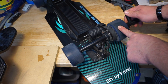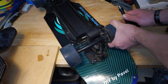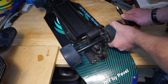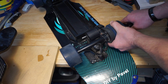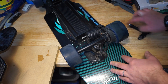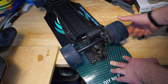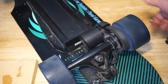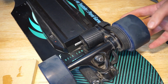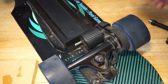What I normally do is start tightening the wheel nut and at the same time rock the wheel. If I feel a wobble I keep on going until the wobble stops. Then I just check the spinning of the motor and the belt — it should spin nice and freely and make three or four turns after you stop spinning by hand.